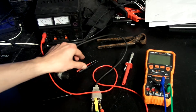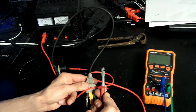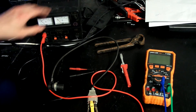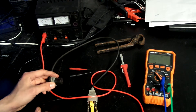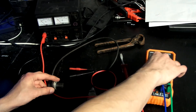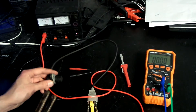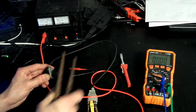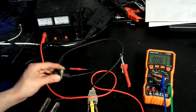Testing the sensor on the car would be difficult, since we cannot really back probe the connector or easily pierce the wires. So we've got a power source, the sensor, a DVM, and some fake crankshaft gear. First, let's test the resistance — 0.8 kOhms seems reasonable. Now let's give it some juice and grab some iron. We see some voltage is induced, and even more so when we switch to AC voltage. This is a working sensor from a different car.